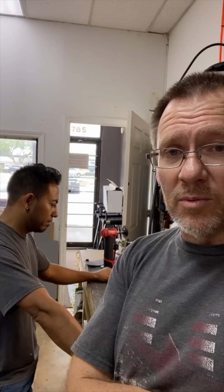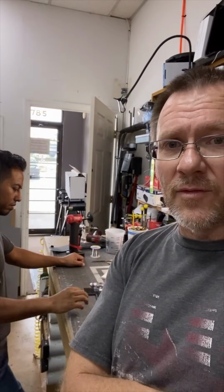Use a finer blade, depending on the type of plastic. If you're going with PVC, a fine blade is fine. If you're going to go ABS, get something with a lot of teeth. And don't go slow on ABS. You've got to kind of move on, because the more time you camp out, the more it melts back together. So it's usually no fun. But a jigsaw is a perfectly acceptable tool to use. With PVC, you can almost get away with a razor knife because that stuff breaks pretty easy.